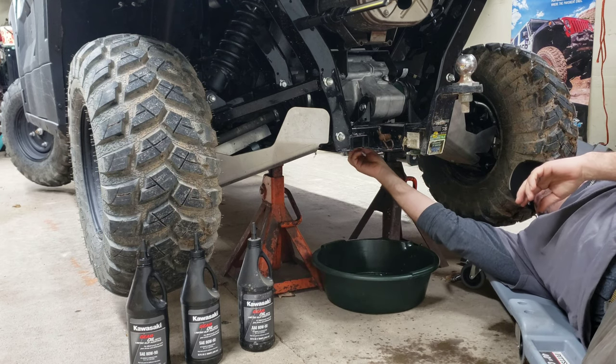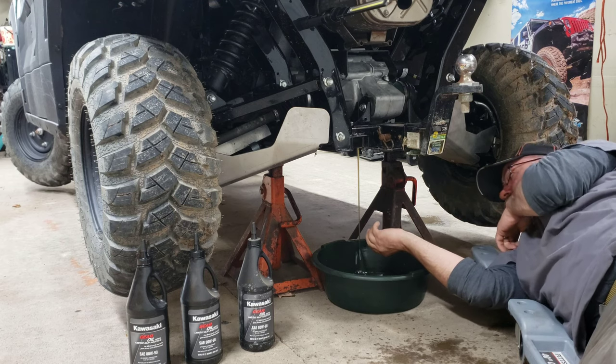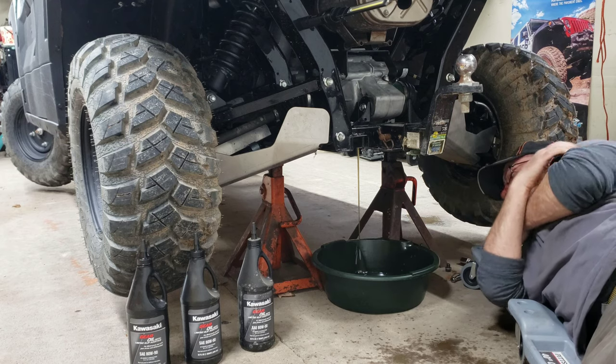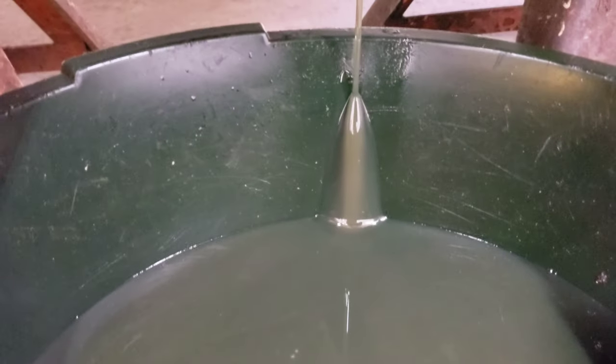Okay, so this is 2.11 quarts for the rear axle slash transmission. Now, surprisingly, this fluid is a lot cleaner than the front axle fluid. I'm actually surprised. I figured this one did most of the work. I'm gonna grab that camera. You can even see that the rear is way cleaner than what I got out of the front. The front differential was very gray and dirty, and I showed you the magnet, what was going on in the magnet. Kind of some cool stuff going on there, but yeah, the rear obviously looks better than the front.